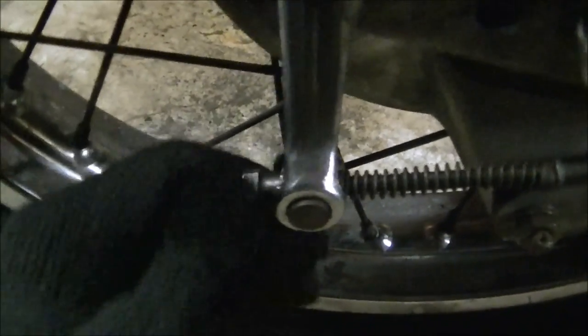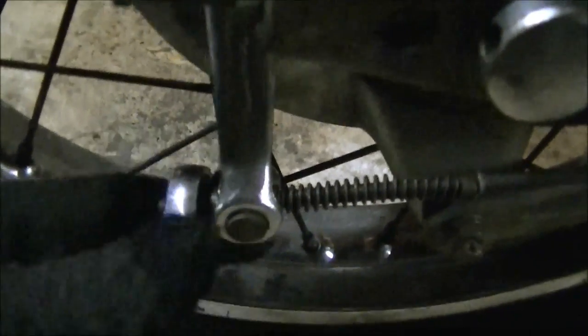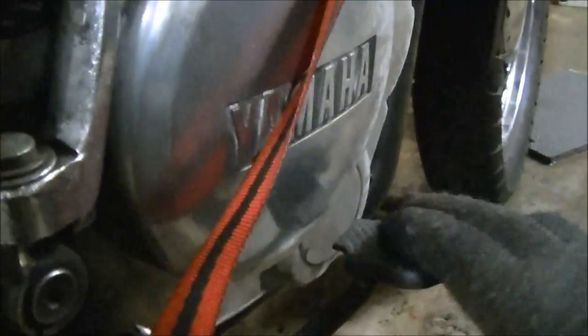The way to tighten it up is to simply turn this nut clockwise. This is a 12 millimeter — you just tighten the thing up. Basically you go a whole bunch of turns and tighten this up until you get to the point where you have the pedal travel you're looking for. Then you grab your pedal and you can see you can't push it down nearly as far.